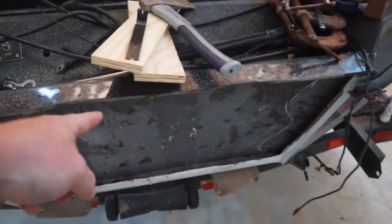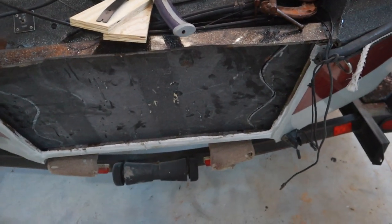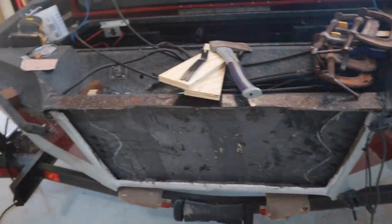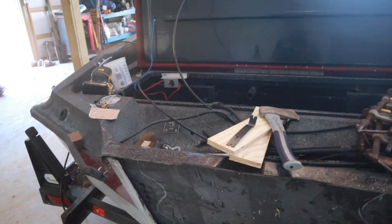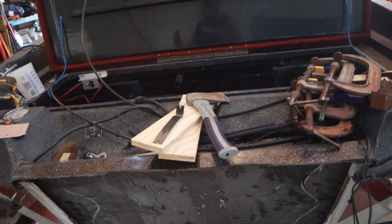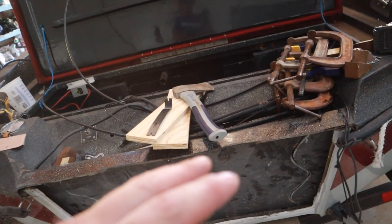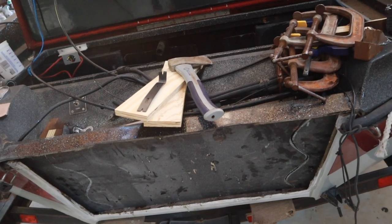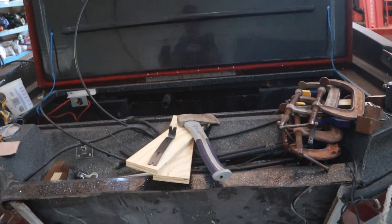So you can see where we had some epoxy spill right there, and that's because I'm really messy. So I'm going to sand some of that off. I'm going to prep a piece of fiberglass, get it cut to the right size. We're going to wet this thing back up, stick the fiberglass on, then wet that up. While I'm cutting the new piece of fiberglass, we'll cut the new piece of transom. When we cut the new piece of transom, I will then wet the backside of that up. We're going to do it in two pieces yet.